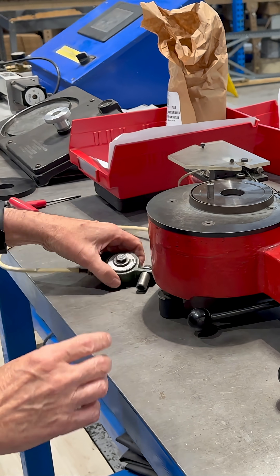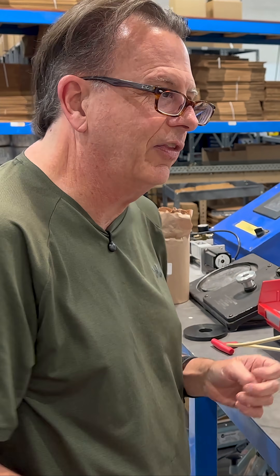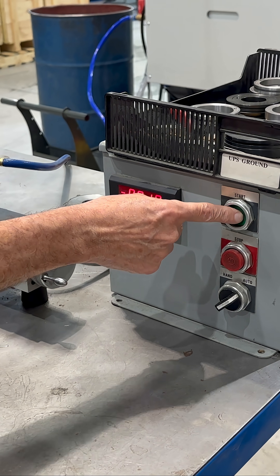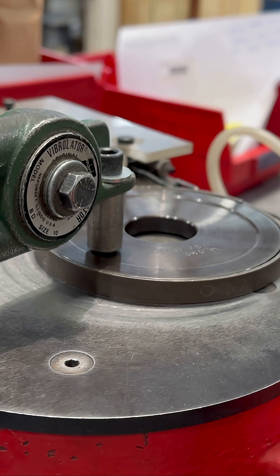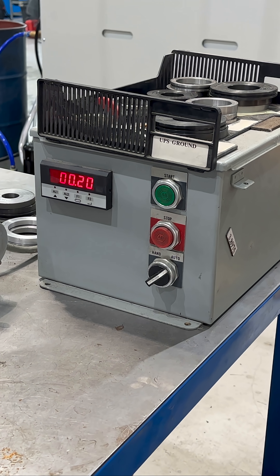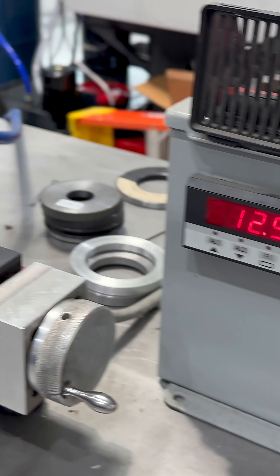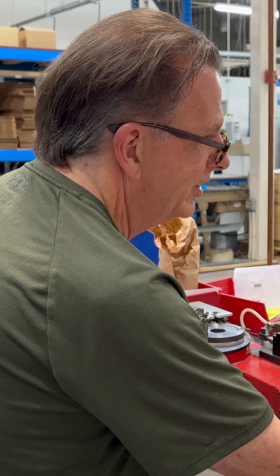We're going to put it in — this is the agitator. It's going to vibrate and shake to remove any friction in the ring stack. We're going to turn it into automatic mode and let it rip. As you can see right there, it's about a 12-pound oil ring. We'll run that one more time just so you can see it again. And that's an oil ring tension test.